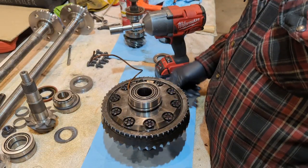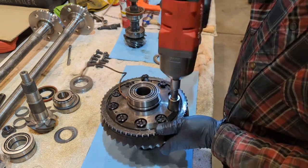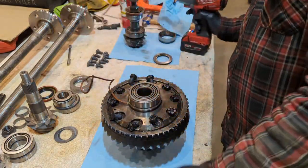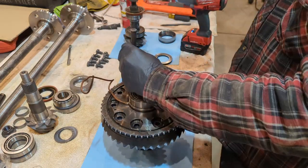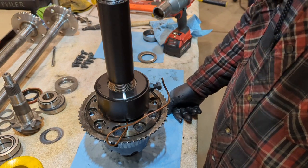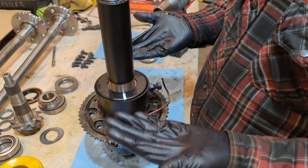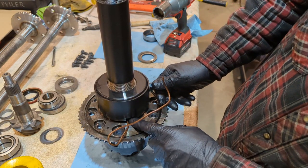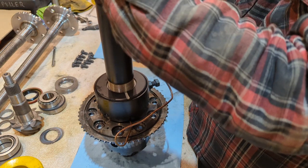So I have the new ring gear in the oven ready to go. In the meantime, we're going to take the ring gear off of this. After you finish getting the ring gear off, you need a clamshell puller if you have an ARB to get that seal housing off, because it's below the bearing and you have to take it all off at once. Now you need to be careful — I put the clamshell on but don't close it all the way so that way you don't damage the copper line right there.